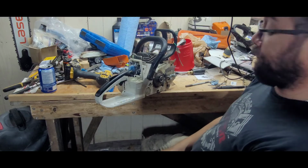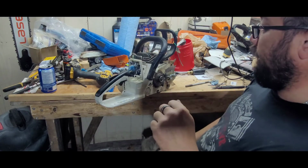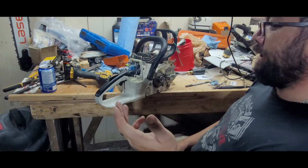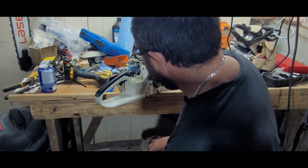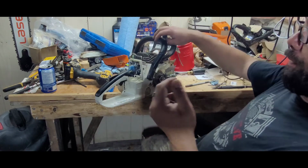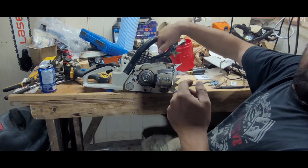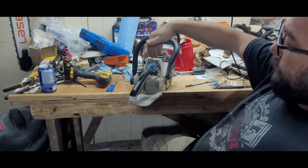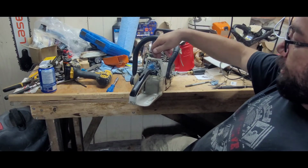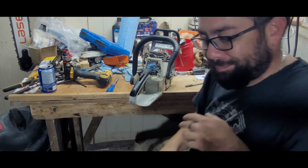Gonna have to do it. I don't have to, but I'd rather be sure. Just do a vacuum pressure test. It's easy enough to do. I mean, got a couple ways of doing it. I use a bike inner tube, cut it down, then I put it between the muffler and the cylinder. And then on this side, I have used a big hose clamp, and it works.